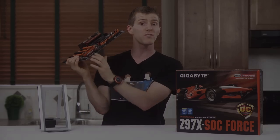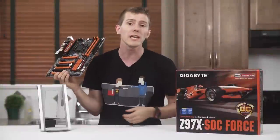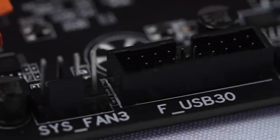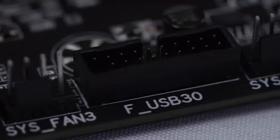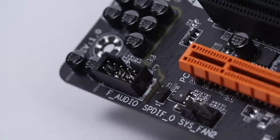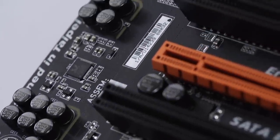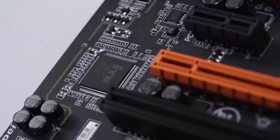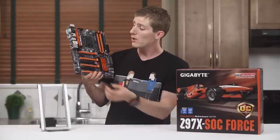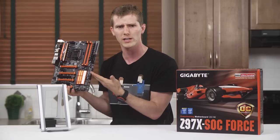Further down we've got a couple of onboard USB ports. These are great for test bench use, or even for normal use if you have something like an encryption key or a USB Bluetooth adapter that you basically want plugged in all the time without it being in the way at the back of the machine. The front USB 3 header isn't really ideally placed but I understand why it's not on the right with all the fancy stuff going on over there. Front audio is plugged into the standard header on the separated PCB that makes up the bottom left of the board. Gigabyte has physically separated the traces, which slightly reduces interference for cleaner onboard audio, and combined with a pretty hefty amplifier and Realtek ALC1150 audio codec, the audio solution on this board should be pretty solid — especially for an overclocking-oriented board.